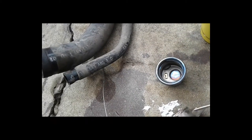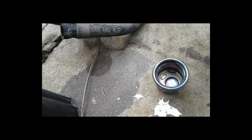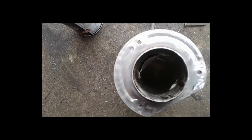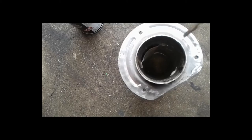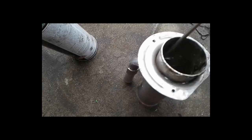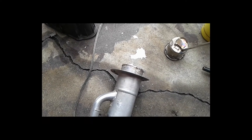The whole piece is brazed in there — it's hotter than hell still. You can see the solder right there, and that's the little flapper. It'd be easier to just cut out the old weird flange and re-solder this back in. I'll also take the vent cover — looks like it's soldered in there too — and put that in the filler tube on the Bronco so vapors don't come out and blow up in there. I didn't realize these things were soldered in; I guess the new plastic ones are different.